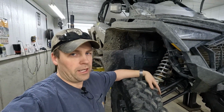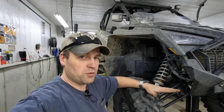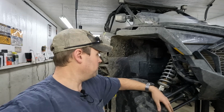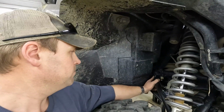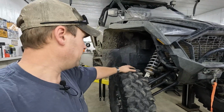And yeah, for the win, taking that bushing out and breaking it into pieces, then pulling that ring out, oh my gosh, 2 for 2. That was the easiest thing. I went into this job dreading taking that ring out, but that method, it pops right out, it was nothing. One of the bolts in the upper A-arm ended up being a tougher job, this guy. That ended up being tougher than that darn ring was. It fought me the whole way, but I got it.